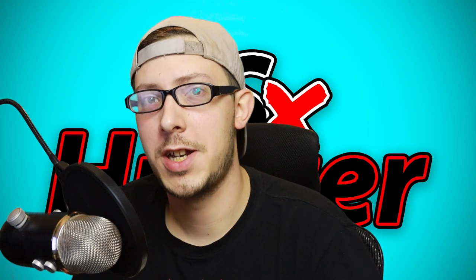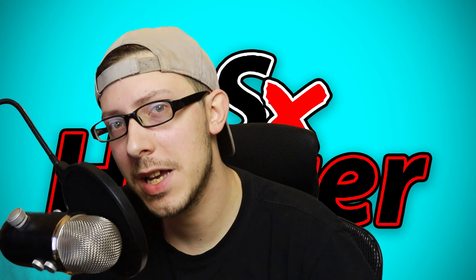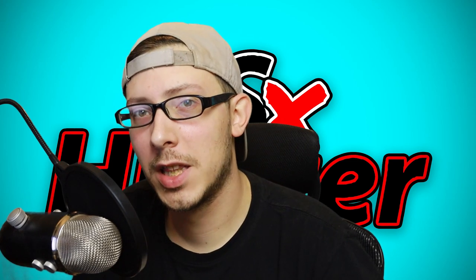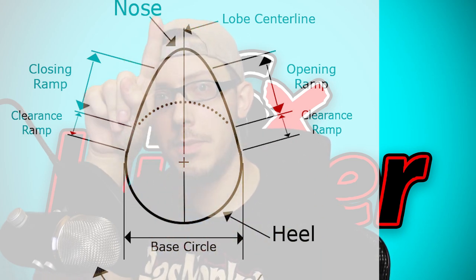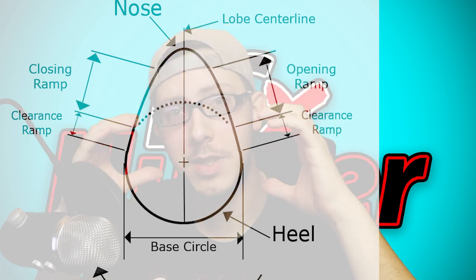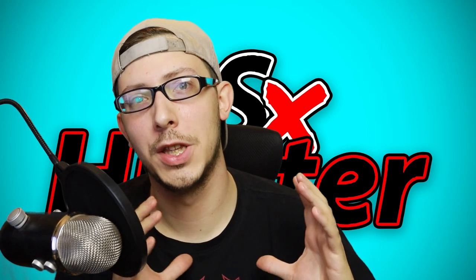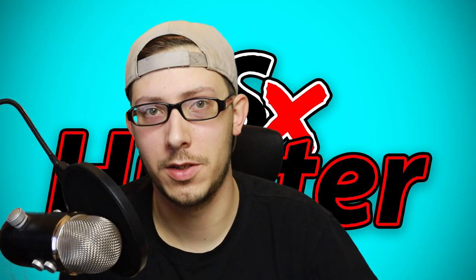The largest thing that's going to happen is it's going to increase airflow. A lot of people get stuck in the raw CFM or the peak CFM. We need to look at the actual full curve here. If we are increasing only peak CFM, we're not actually helping that much. Your cam really spends a very little amount of time at peak lift — it's going up and back down. During these two chunks, it has a time period where it's going to be at mid-lift, so it's important that your head flows well in mid lift. The goal is to have the lowest intake CC while also having the most intake flow, and this also applies to the exhaust as well.